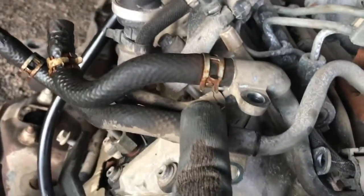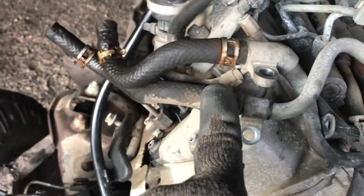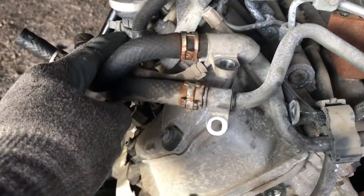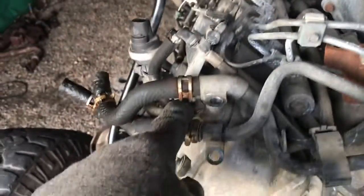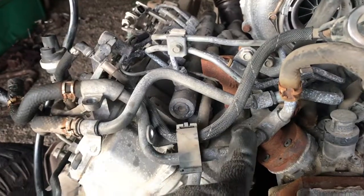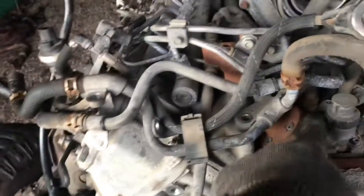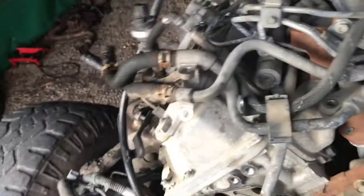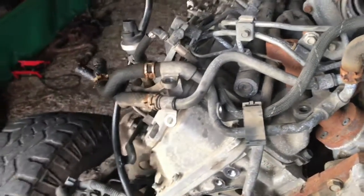Pull this bolt out on this other fuel line, this one out of here, and this little return line off of this little return regulator — or actually that might be a metering valve, I'm not 100% sure — ties in right there, going back to the CP4. This is all going to be only put in what we need. Not sure if we cap this here or run this little line all the way over here. We'll see what we can find for a fuel filter delete kit.